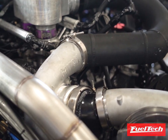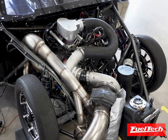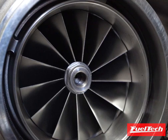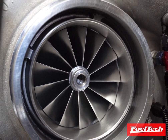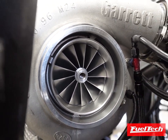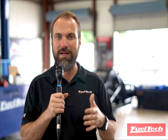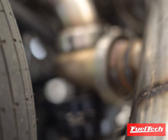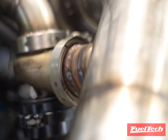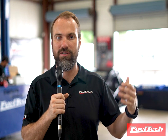Both turbos will be working at very low effort and low speed. We've been seeing, for example in this rotary, each turbo running at 60,000 RPM on the compressor wheel to make around 80 pounds of boost — so it's really smooth and easy for the turbo. This also helps with back pressure and how the engine breathes exhaust. Another benefit of a compound system is that you can achieve high boost levels without sacrificing back pressure through extreme turbo speed.